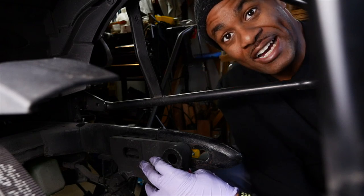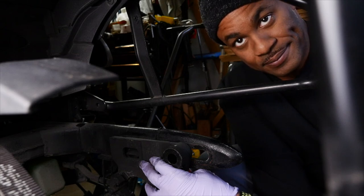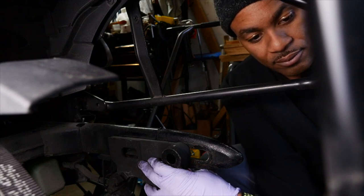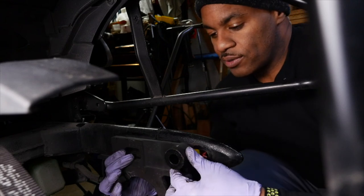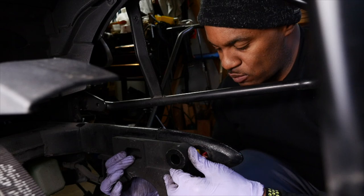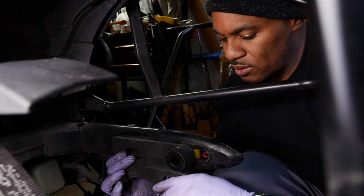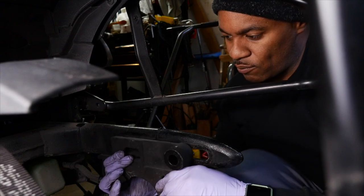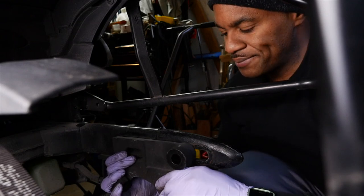The only thing with that is you got to get it on there with the wheel. So you want to try and make sure that this is on there. You're putting the wheel on and you want to just try and make sure that this is inside of that indentation that's in the swing arm, because if not, it's going to be a real problem trying to get that on. So just try and make sure that that's in there and it's in place. That way, once you torque that axle nut down, all of this stays put. Okay, so we'll cover that.